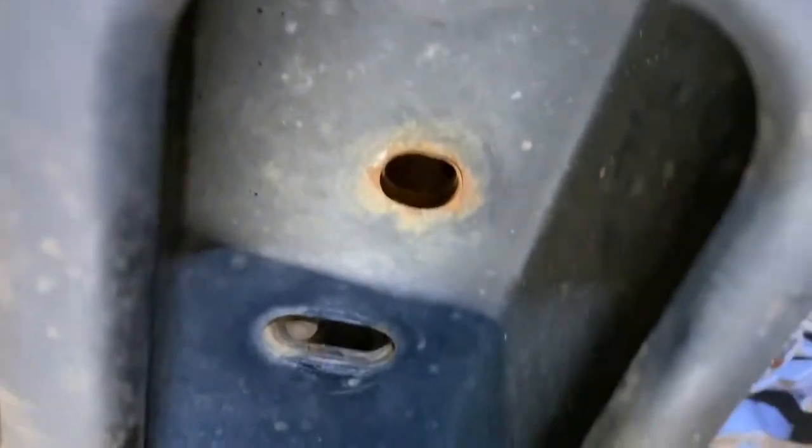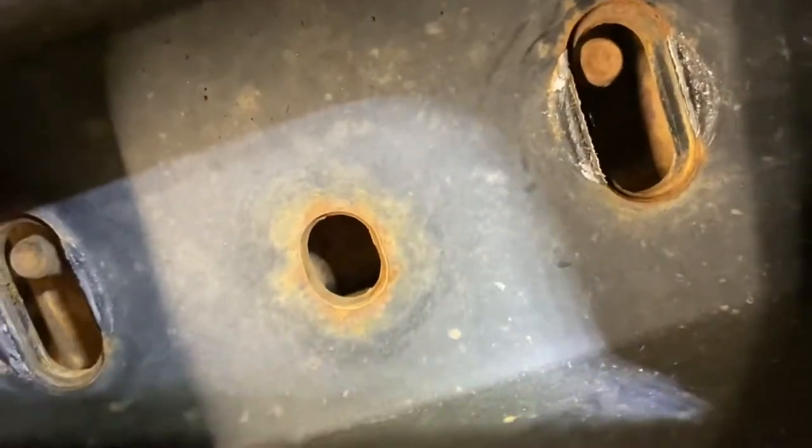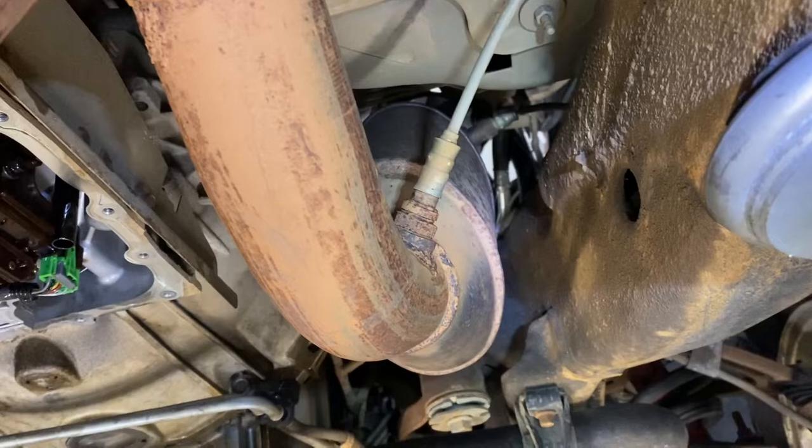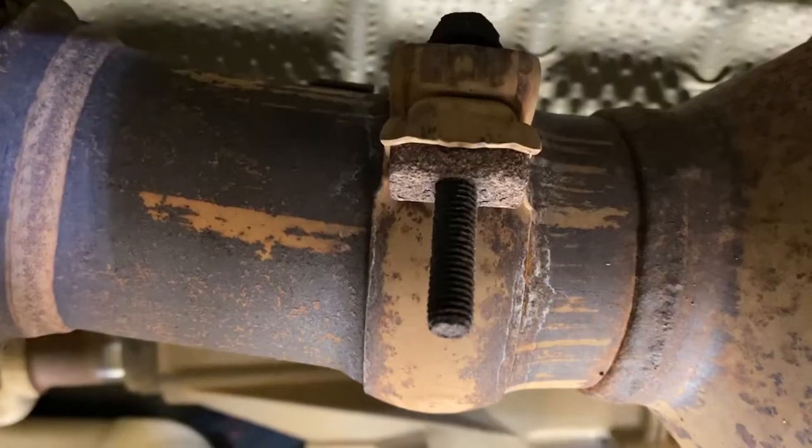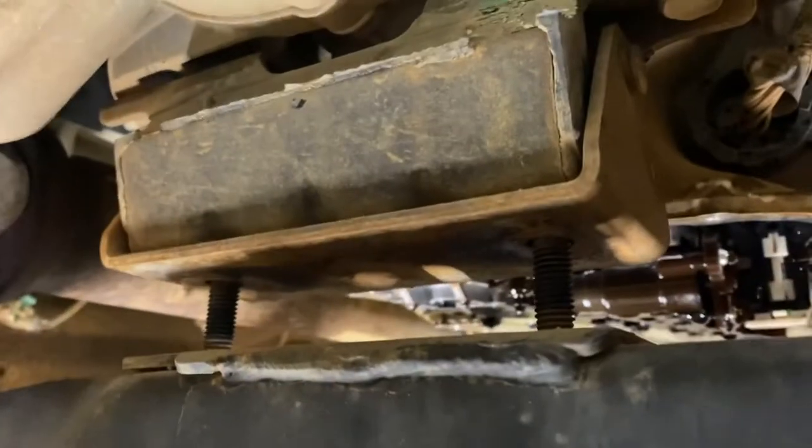That's a real pain — as you can see, I had to jack the drivetrain components pretty far up off this cross member to gain enough clearance to clear this crossover pipe. Another option would be to disconnect the crossover pipe, but then I'd need new gaskets for the flanges at the manifolds. If you've ever dealt with heat-cycled parts, that can be a dangerous task hardware-wise. This truck's lived its 11 years in the south, so it's not as bad as northern trucks, but I still don't feel like breaking hardware and opening a whole other can of worms.